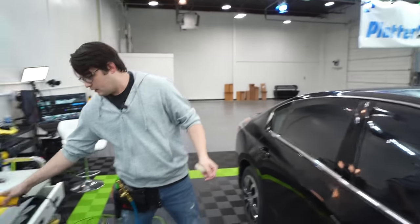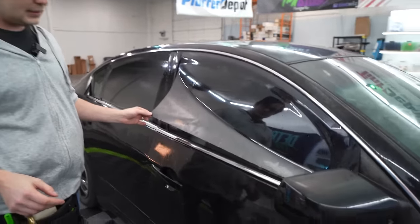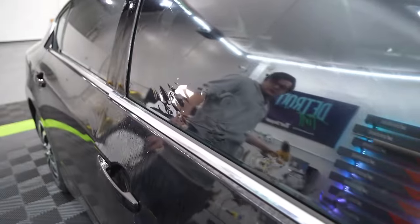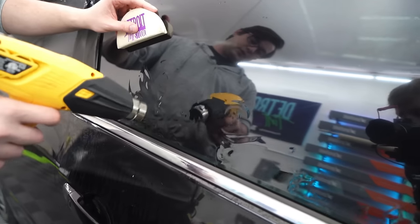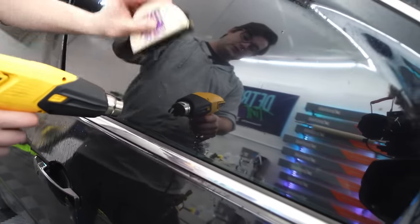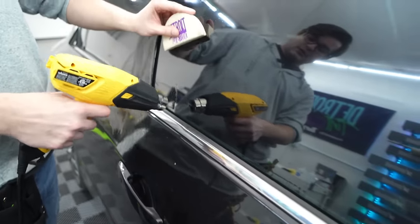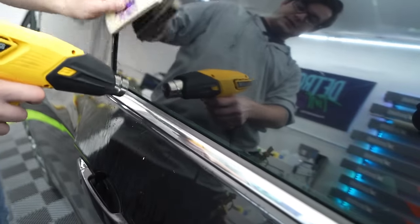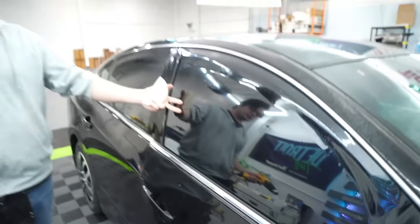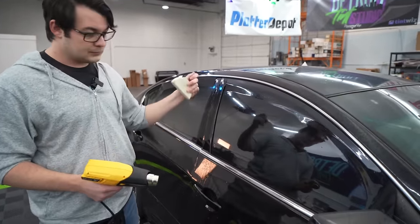When we get to this point — I actually never learned the double snap myself. From what I understand, you then pick it back up and drop it back down, then press the sides down with air in between. So you're going to re-shrink basically the area you just shrunk. There's a lot more film sitting up off the glass now, so you can create a nice even shrink. Get those fingers down, pick it back up, knock all that air out, let it float off the glass, then re-shrink it. You're really just getting all those spots to even out, and it'll tighten up the window. I know this is a popular method — it's a pretty foolproof way of shrinking. You shrink it, pick it back up, lay it down, shrink it — you're ready to go.